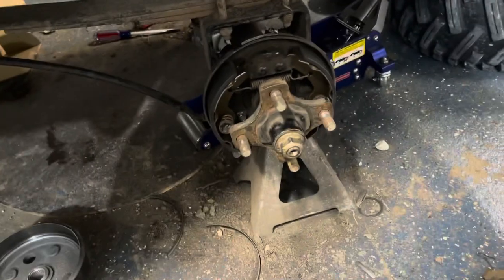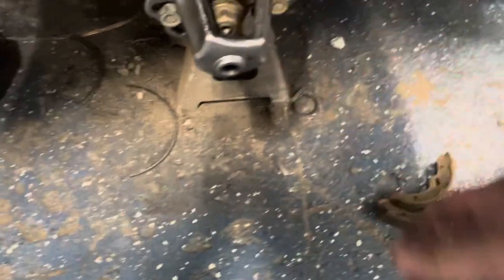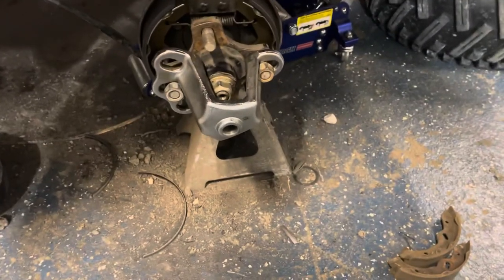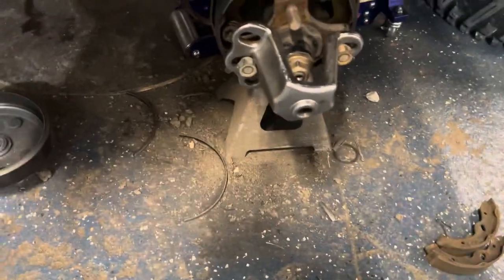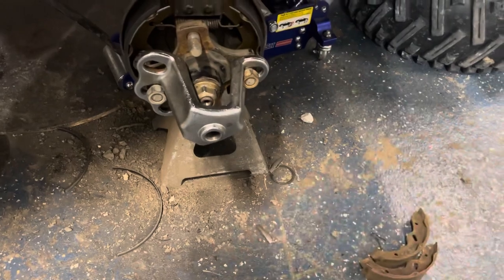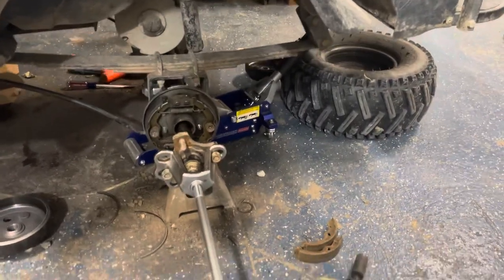The bearings are right here — my kit with bearings and seals. I've already taken the outside clips off. So I'm going to get this set up with a slide hammer. I have it like this because the lug nuts won't go any further in — it's so tight right here. But I have the axle nut on here. It's basically like a full floating axle. So I'm going to attach a slide hammer in here, pressing against itself. I'm going to slide hammer it out. First time's a charm — that's out.